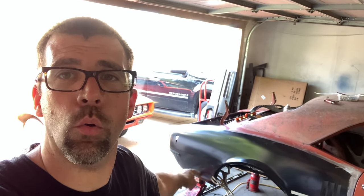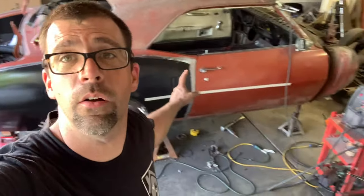The quarter panel is all welded in and done. I haven't welded the back corner yet, haven't done the wheel well arch or the back, because I want adjustability when I go to do that tail panel. I also have a brand new trunk deck — the tail panel right now is keeping my quarter panels at factory spacing, but my replacement trunk deck may need some massaging, so when I get that trunk deck mounted I'm going to use it as an alignment piece along with the tail panel. That's the next go around. Hit subscribe, like, and share with your friends — and next time, when I get that tail panel in, we'll also do a tally on how many hours and how much we've spent to get a body shell nice and rust-free. Drop your guesses in the comments. I'm sweating and overheated — see you next time!